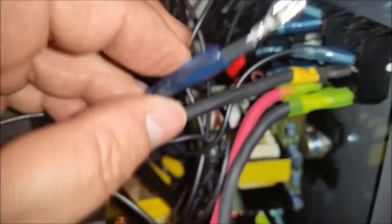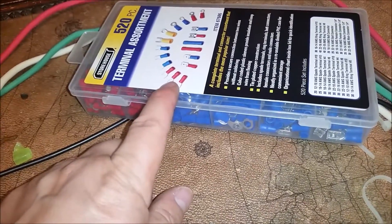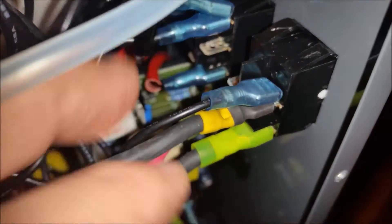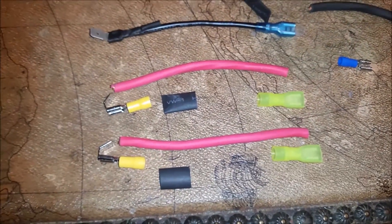I've got these two wires crimped together on a crimp, and I used the original shield because it looked better and this wasn't really insulated anyway. I had to grab a 14-16 crimp from the garage and cut the blue off so I could use the original jacket on this one. Now I'm going to build the jumper cable that goes from down here to over here — this will have a piggyback on it — and then build another piggyback cable going to the red side. We have two piggyback sides and two regular conductors, so let me get those built.